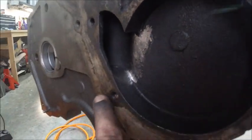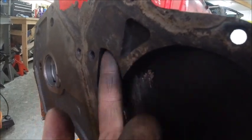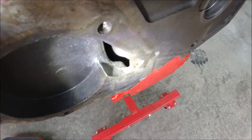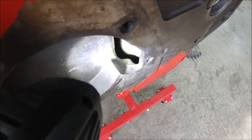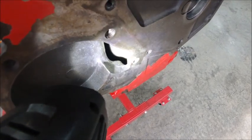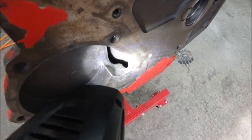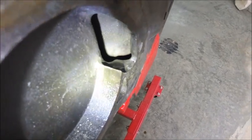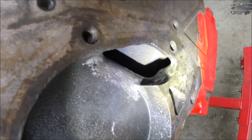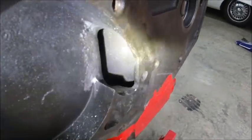I've done it before, so basically what you're really trying to do is just kind of curve this in here, open up this area, and then right in here just take that little flat out right there — that should take care of everything. I'm going to turn this upside down and show you. You can see that little tit right there — you just want to clean up those tits and knock the corner off, just clean that up. Nothing crazy because you will get into that bolt hole, that's the last thing you want to do. I didn't take much out — all I did was just take the flat off to open it up and smooth it out. All you're trying to do is take some of the edges away to help move some volume, that's all.